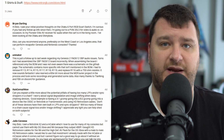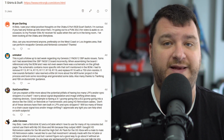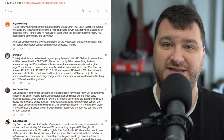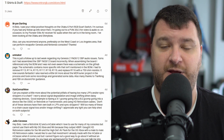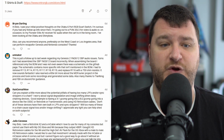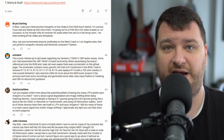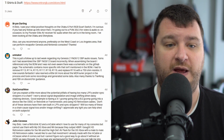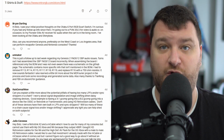So to answer that, I really liked the Otaku. It's a basic manual switch. It didn't add any features, but more importantly than anything else, it didn't seem to take anything away. There didn't seem to be a noticeable signal drop. It didn't mess with anything. The only thing I wasn't able to try was a lot of stuff with composite video sync to see if maybe that kind of jailbar interference would spill over. But overall, for the price, it seemed like a really great starter switch.